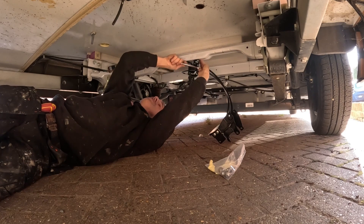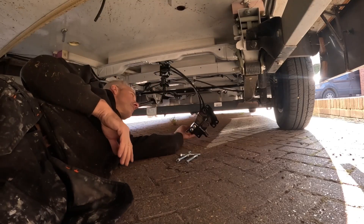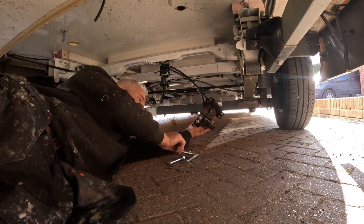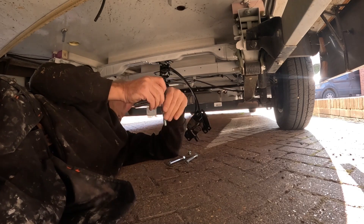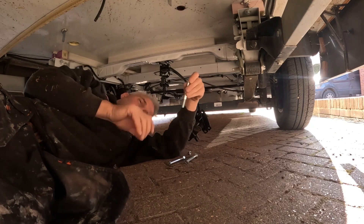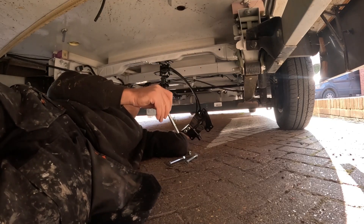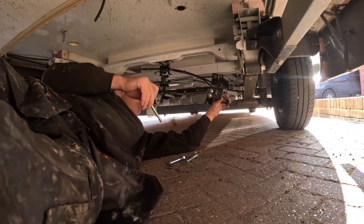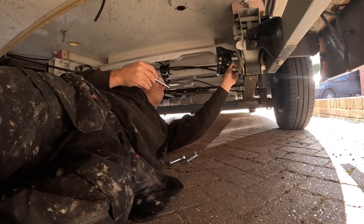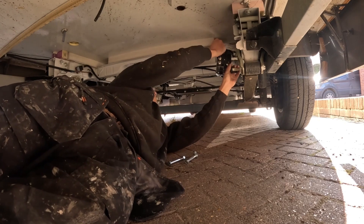Go around all four just making sure they're nice and tight. Yeah, that feels good - all sorted. The bolts for this assembly weren't supplied so I had to buy those additionally. I measured it at about 90mm, so as long as they're a minimum of 90 to 100mm you're fine. It's a case of sliding that up, lining it with the hole, and shoving the bolt through.